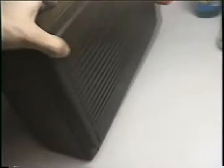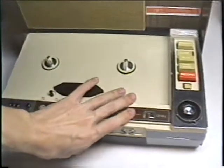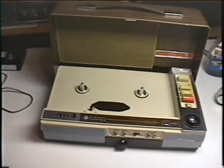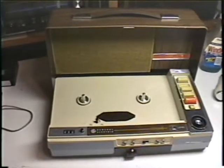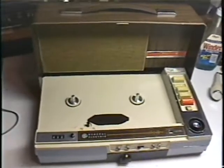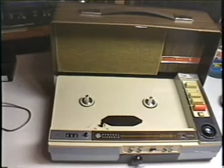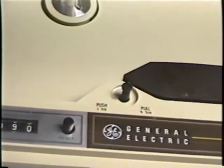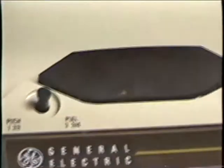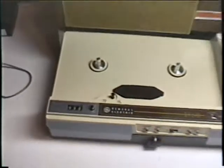It does have a battery compartment on the back there, but it's very hard to open. I did a lot of work to get this machine going — it paid off. I fixed the non-erasing problem; I think it was a soldering joint. I put a belt back in place and replaced a square belt with a slightly less tight round belt to hopefully get the speed thing to be more reliable. This is a push and pull speed switcher.